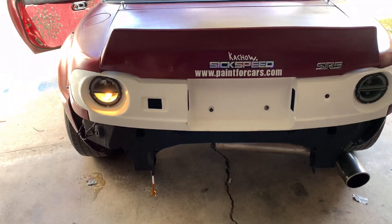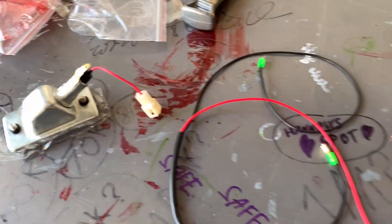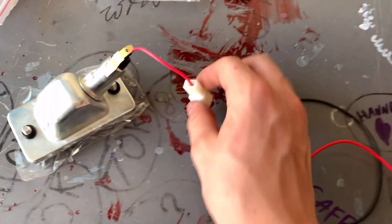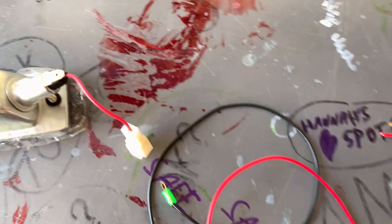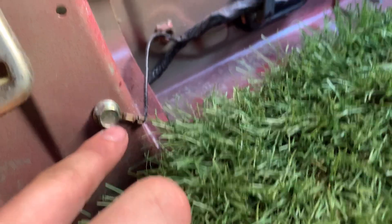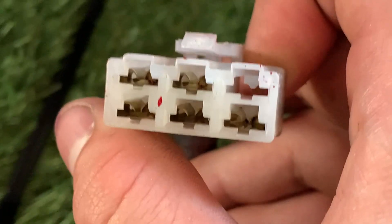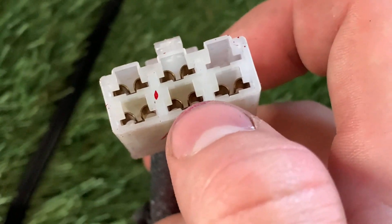Now I just have to do the one part I'm really dreading, which is the reverse light — and I'm really bad at wiring. There's a long cable and a short cable with these little connectors. The short cable goes right here because it has the male connector, and the long cable goes over there. There's even a little negative right there, which makes sense for where to put the negative slash ground. I just don't know where to put the positive. I'm thinking if we go over to the OEM harness, that little middle pin isn't used by the other lights — my guess is that middle one is for the reverse light — so I'm going to tap the positive into there and see if I can draw power from that.